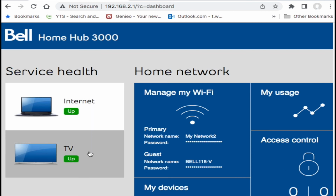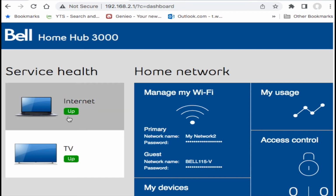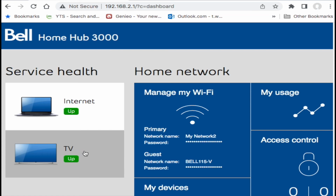These are two different signals right in on the same internet line because I have IPTV, which I'm getting from my ISP as well. If my line was down, it would say down right here. And at this point, I would want to start looking at what is happening before the modem in my home. Like, I can't go outside because that's the ISP's area. They have to look at that part. But at least I can make sure that the connection between the modem and that jack is secure.